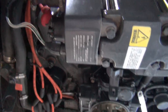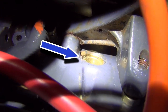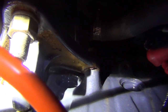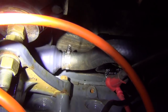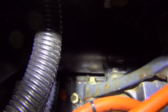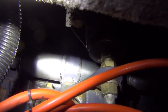I'm going to flip this all upside down. This is where I'm working. If you get down in there, you can see there's just that little gap and that's where the freeze plug is — that's why it's so hard using the OTC kit to get it in there. I figured OTC on an OMC, I'd be okay. Not so. If you get over here, you can see that one — it's kind of a mirror image. You can see that's the bolt right there that goes in from the bottom side to secure the mount, so it's not like you can support the motor and pull the mount very easily. There's a lot of teardown involved. You can see the nut and the adjustability to make sure your shaft's lined up perfectly straight through the gimbal bearing.